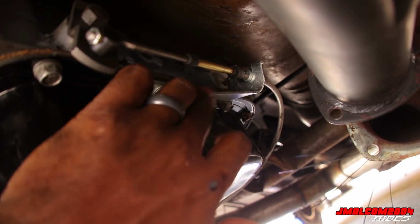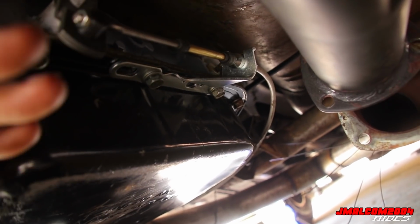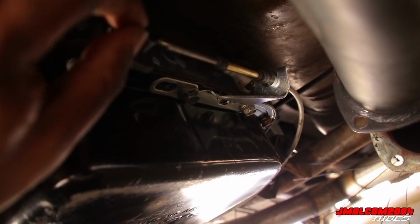That's the one that worked for the 350 transmission, worked for the 400, and I got three of these now. So I got two more including this one. So I didn't really need it, but the bracket kit I bought came with all the brackets for different transmissions, and it came with this selector piece I showed y'all. That's what my problem was. I don't know how it was working before, but it was in a bind and it wouldn't give me enough thread to put the lock nut on.